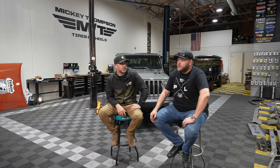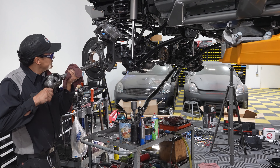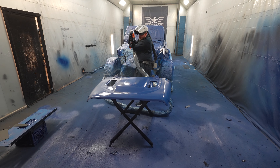There's a lot of Yukon stuff coming. Since we're going to stay on the 44s and wheel on 40s, we're switching over to Yukon chromoly inner axles. We're also going to throw in some Dynatrac ball joints, because that's one of the big failure points when running bigger tires and bigger suspension — you're putting more stress on that front axle and steering.